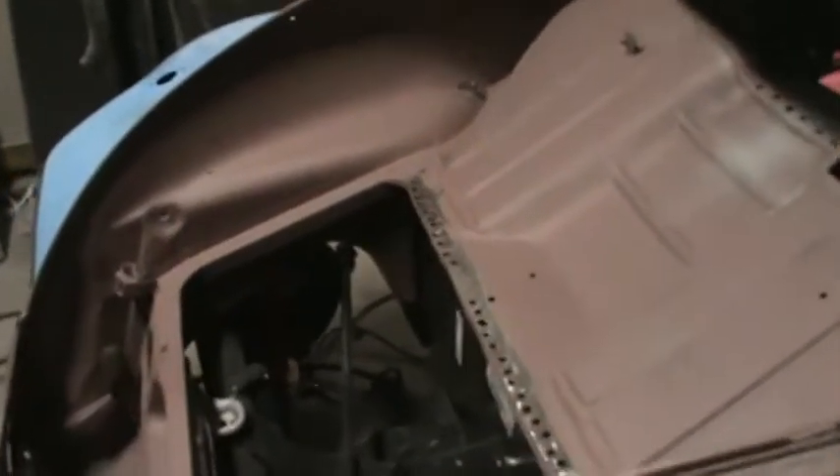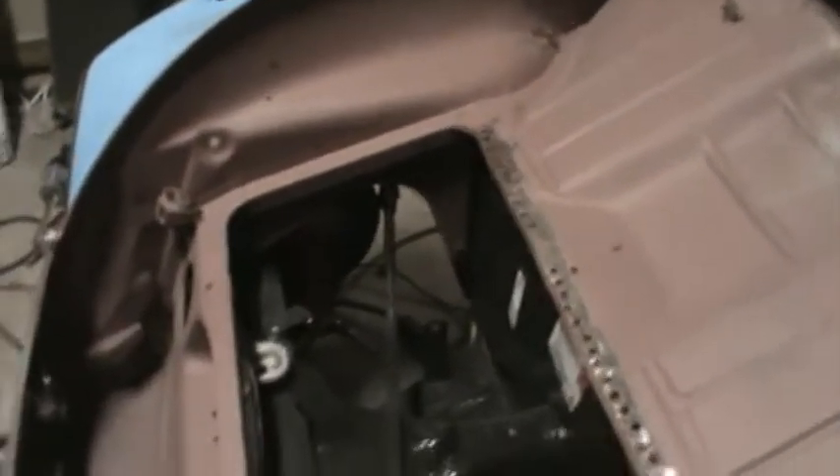Those are actually access plates you can cut out and buy when you put these in. I was able to clean two of them instead of replacing them, so yeah, I think those came out really nice. I don't know, I've seen some online that don't look quite so nice when they're put in, so I'm pretty happy with the way they fit the car. Until the door hits them and doesn't shut, then you'll hear me screaming. I need to trim the inner fender well down here to fit better on the aftermarket firewall.